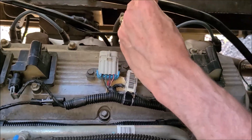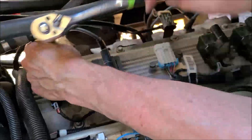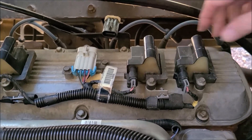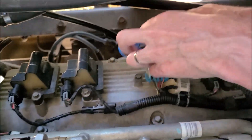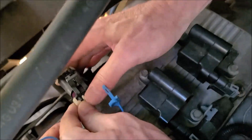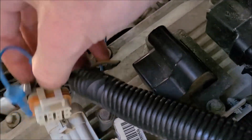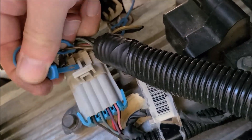Cause I'm concentrating — just like Dad used to do. Alright, I've got them started right now. I'm going to go ahead and plug up my coils, then go back around and get them all snug. I don't have a torque wrench with me but a friend of mine does, so I'll get his torque wrench before we leave and put the final torque on it. All we have left to do is plug up this harness and all the other stuff — spark plug wires, temperature sending unit. There we go. Now put that little clip back in there and lock it.